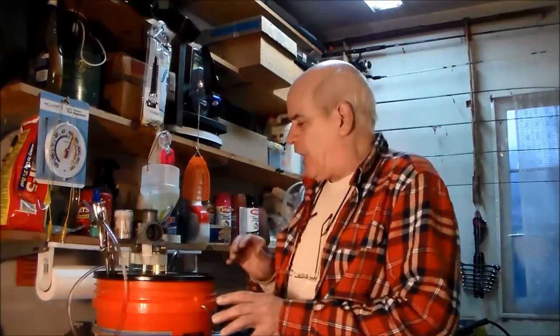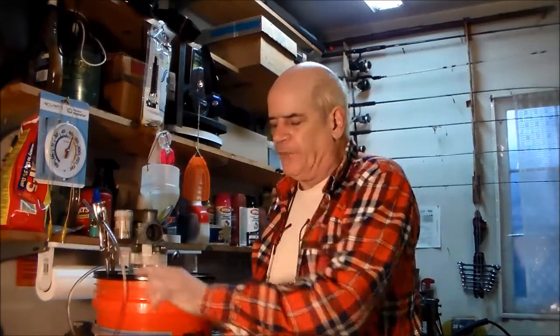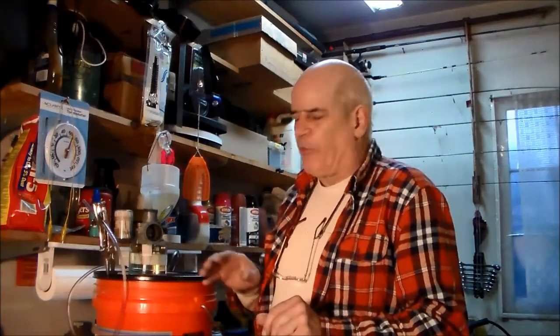Okay, well, everything turned out really good. We have no leaks. I let each one set for about 5 minutes or so, and the fuel level just stayed right where I set it. What's nice about this is I can see each carburetor when I put it under demand, by draining a little bit out. And all three of them, there's no float sticking, no jerkiness, no anything. They just come down and drop about a 1/2 millimeter the way I was dribbling gas out. And when you stop the flow of gas, they just pick up and stop right where they were the first time.